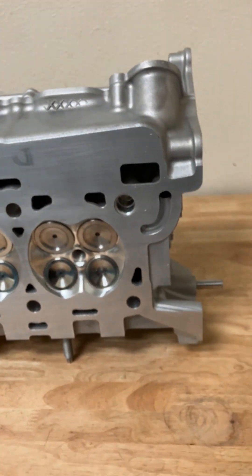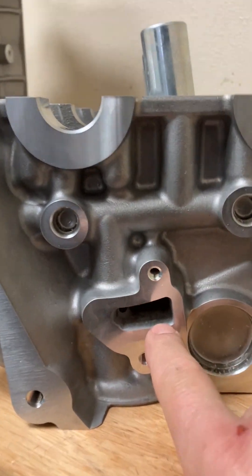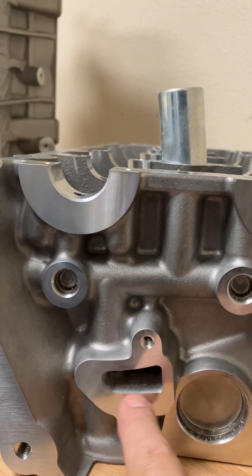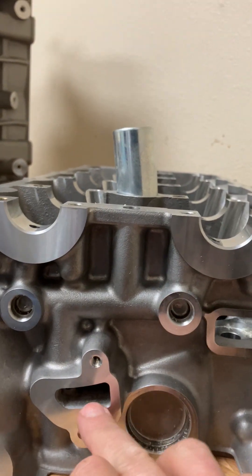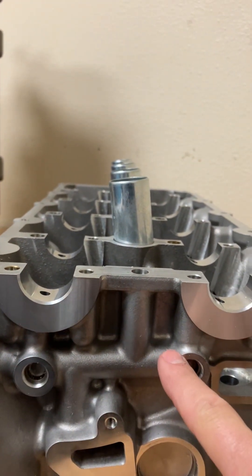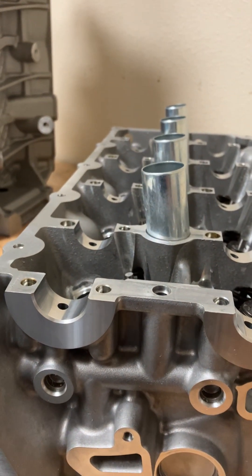So let's go over to the head. In the head, the oil comes up through this passage, right through here. On the front of the head, the oil comes up through this passage — here's your tensioner. First and foremost, there's a hole there that feeds your primary chain tensioner. So if you have a leak here or a faulty tensioner — very rare, they're aluminum and iron, they don't have gaskets — this will start making noise and it can bleed off pressure that's going into the heads. So it goes up into this tube, and then we have plugs here and plugs here. It goes across and also goes up, instantly into your secondary chain tensioner. If you have a chain tensioner that's losing pressure or something's going on there, you've got a problem.